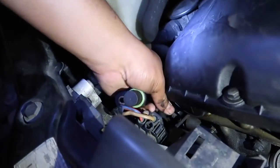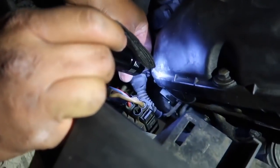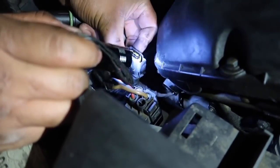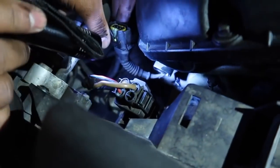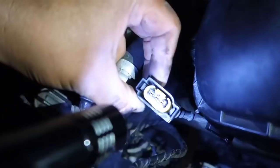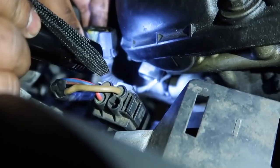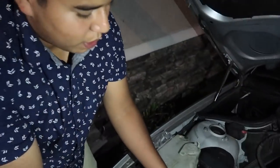All right, guys, it is late night, but Erlon found out, show him what you just told me right there. So about how you know it's a sensor, not the actual camshaft. You can get camshaft B over retarded, which is the Vanos's fault. But in some cases the sensor goes bad, or you get oil like this. Can you see oil in there? There's oil in the sensor and in the connector. So that means it's not getting a connection, the sensor's shot. You can see the sensor down there has oil on it all over too. You might get lucky by switching out the sensor with a new sensor. But if you're unlucky, it ran through the wire onto the DME and the fault will never go away.